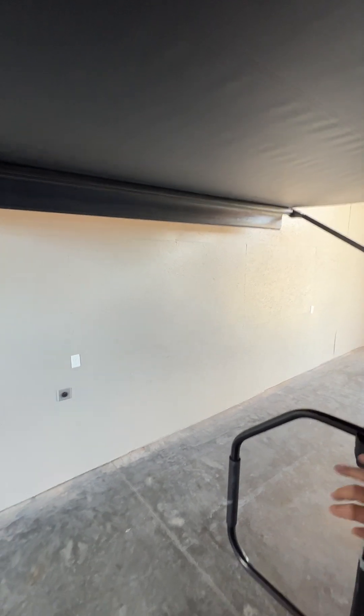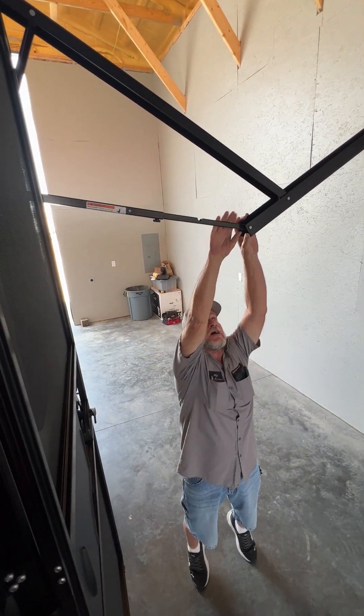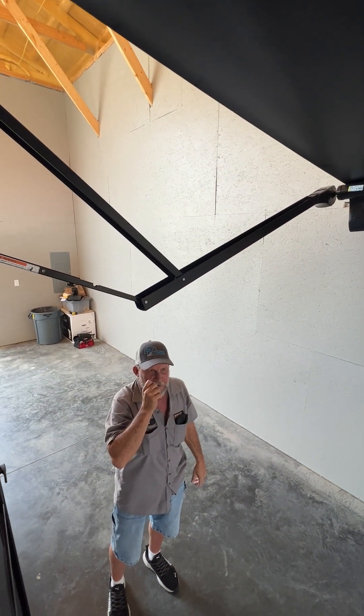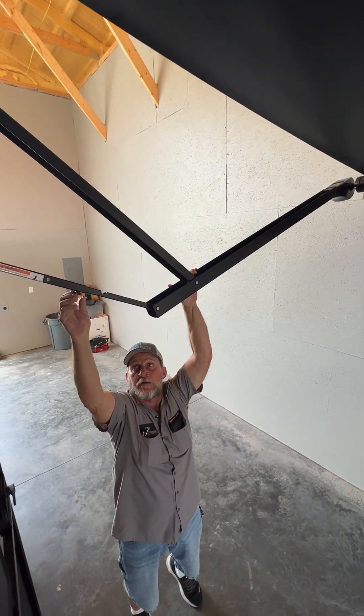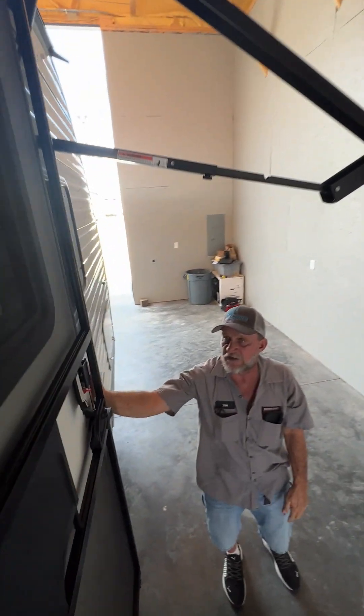It is also good to make sure that the trailer is not up against a tree or that you are not too close to the trailer in front of you so the awning gets fully extended. On each one of the arms, there is a pinch point down at the bottom that you can pull down against and then tighten up the black knob — this puts a pitch on the rain coming off this corner. You can do the same thing with the back arm. Loosen it back up and it allows that to slide back out so that when the awning goes back in it lays inside the cradle on the arms.